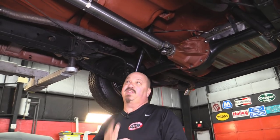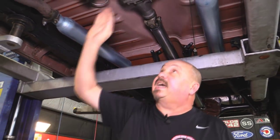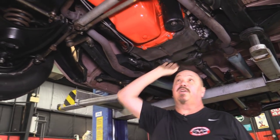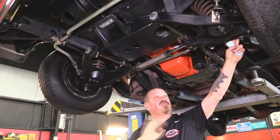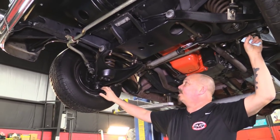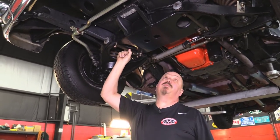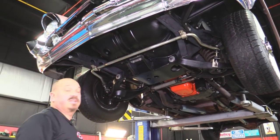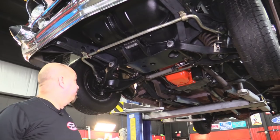The guys will pull the brakes completely apart, make sure everything's in good working order — make sure the wheel cylinders are good, everything's installed correctly. She's got glass pack mufflers on her. It's definitely got a brand new drive shaft, brand new U-joint center. It's got a 1957 cast iron PowerGlide — we do believe this is the original transmission for the car. She does have power steering on her, and a lot of those components have also been replaced and checked out. They're all in good working order. We've got new shocks up front, the guys check the ball joints. We've got drum brakes up front also, and the guys pull those apart to check all that out. Looks like the flex lines are new, looks like the springs are new. The dog bones here look like they're new and the bushings are newer. Big sway bar on the front. The front frame here is nice and straight — doesn't look like it was ever in an accident. Chrome on the bumper looks great. This looks like a brand new 1957 Chevy underneath.